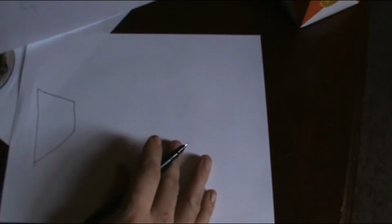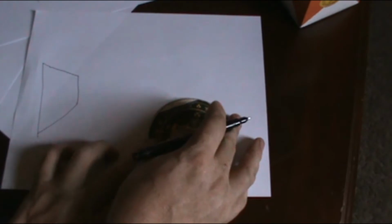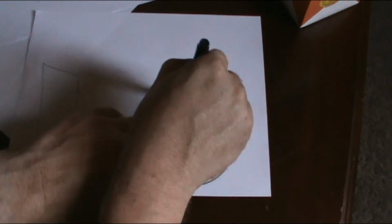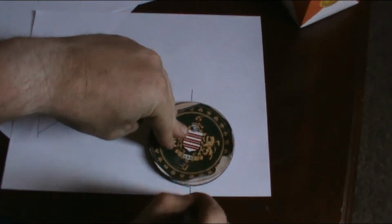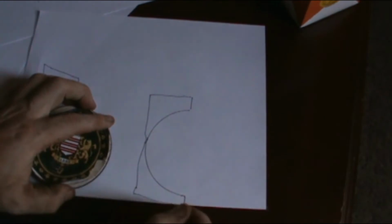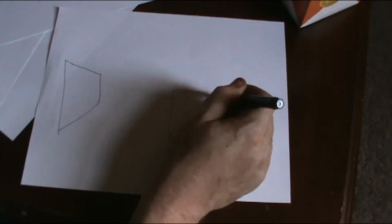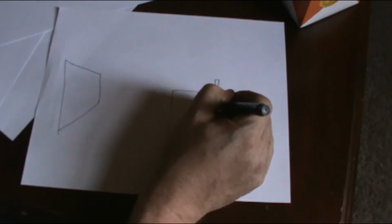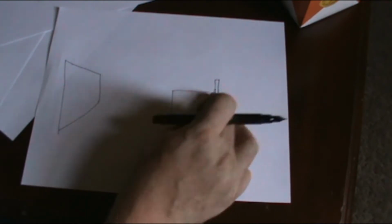to check your pinion depth, okay, once again, this is my pinion gear, and I'm probably going to be able to draw half of this, but you'll get the idea. This is my carrier, not the cap, the carrier. You're going to want to take that metal bar however you can get it. This isn't going to be exact, just pretend like it's coming towards you, and you're going to hold it as flush as you can right here.